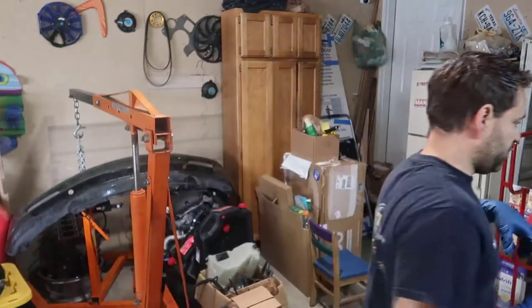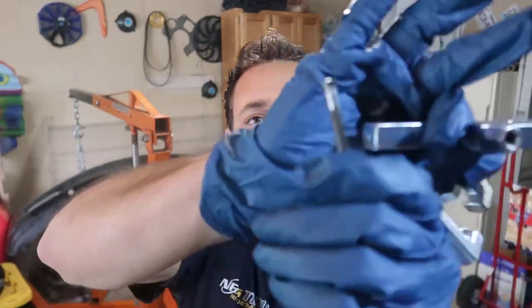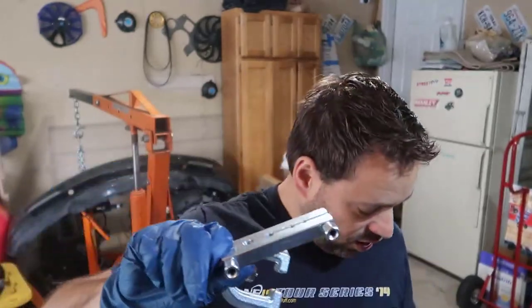So I came again, I got a little piece of tube, and I made a flare. I'm gonna show you. I guess you can kind of see, right? Yeah, see how beautiful it is? So this one I made putting my tube on the first one, which is 4.7, even though when I close it, it doesn't close all the way, which kind of makes sense, because if it closes all the way, it means that it's not squeezing, right? Anyway, I made one flare so far. Look at that. There's not a lot of burr, or I mean, it is clean. This is very, very clean. Yep, and my thing goes all the way to the end, which the other one was a little tight.